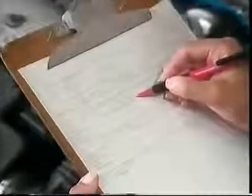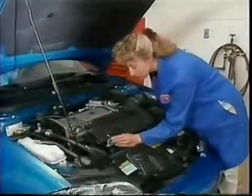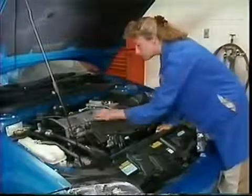Here's a known good vehicle road test example where the customer states there's hesitation on acceleration. The system check and a visual inspection identify nothing, but you suspect the MAP sensor, throttle position sensor, or the crank position sensor based on previous experience. A vehicle road test with the TECH 2 to recreate the condition is a good idea.